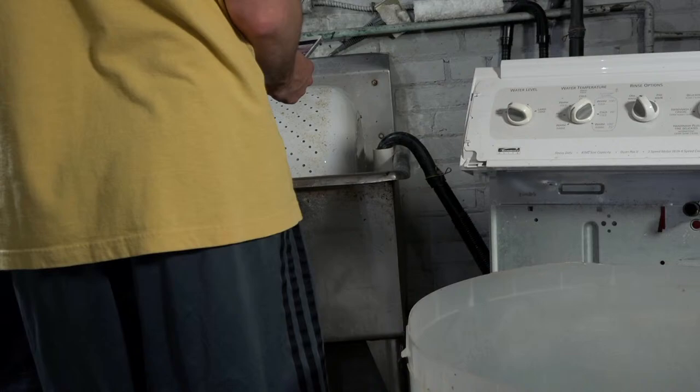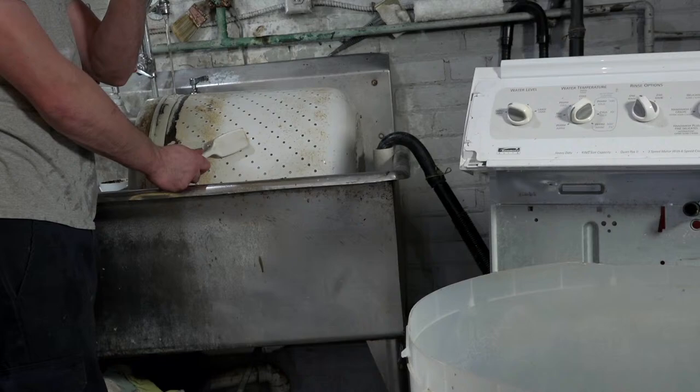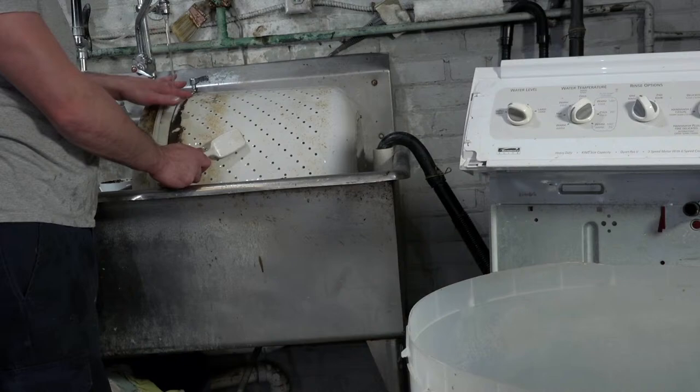No, man. He's got two wires. He's got one with the plastic coating. That one goes at the top of the thermostat. And then that big, thick wire only goes into the heating element. It only fits once. It won't fit anywhere else. And then the jumper wire goes between the thermostat and the heating element.